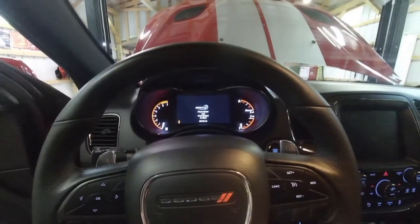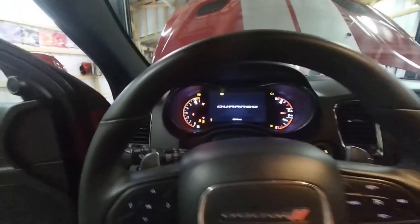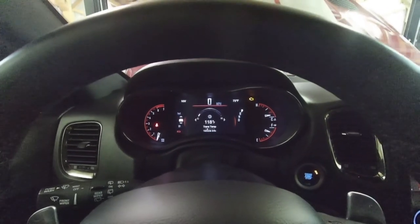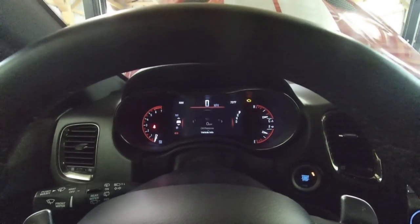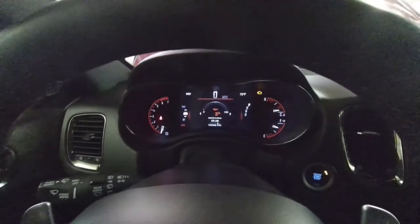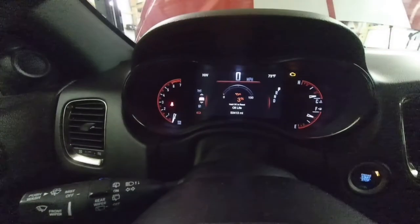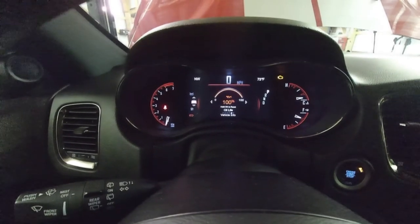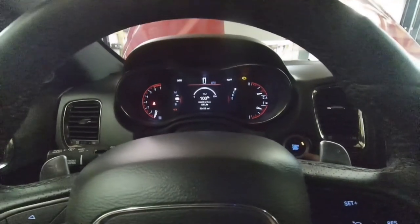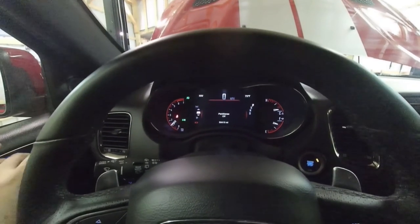Now we're in the truck. Have it in run with the engine off. From the speedometer, push down and go to the truck icon, then navigate right. You'll see transmission temperature, oil temperature, oil pressure. Hold OK to reset oil life — I'm going to hold OK on my steering wheel. And there we go, all set. Now put my foot on the brake and start the truck. Let's go make sure everything's good and nothing's leaking underneath.